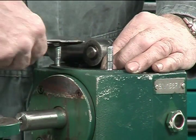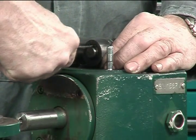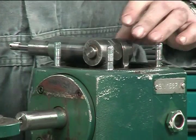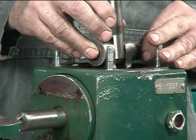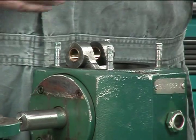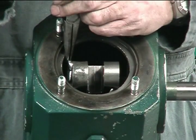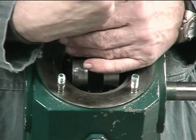Now, one of the retaining rings at one end of the fulcrum pin can be removed. The fulcrum pin can be pulled out of the connecting rod small end bearing and actuator shaft bearing. Slide the connecting rod as far to one side as possible, and with a pair of pliers, remove the oil flinger from the crankshaft.